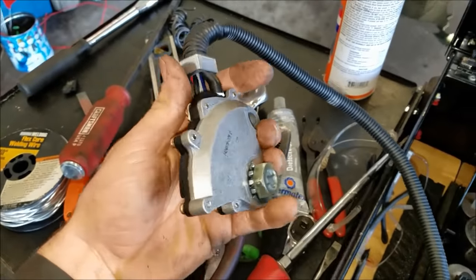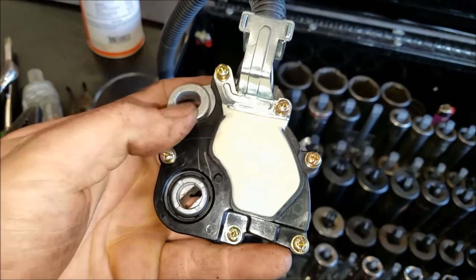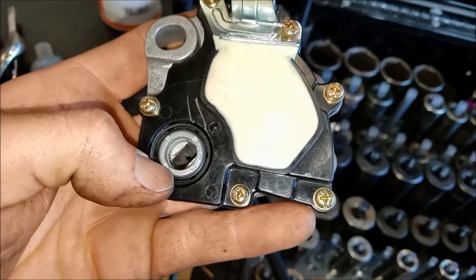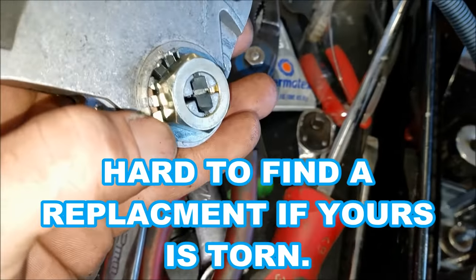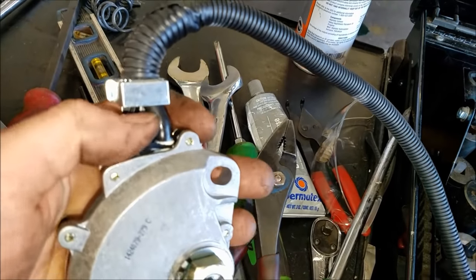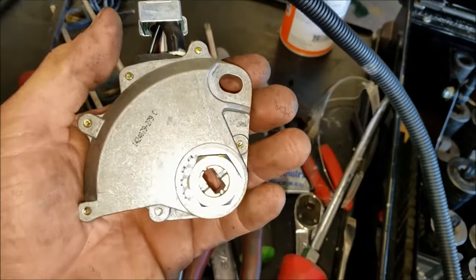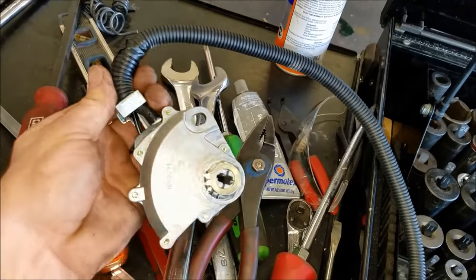Let's note here — you can remove this and then actually remove all these Phillips screws on the back and clean this thing out, but there are a few things that are not necessarily serviceable. You have a seal on this side and a seal on this side as well, and then you also have a ventilation tube that goes up into the harness here to keep water out of there, so make sure yours isn't cracked or anything like that. I'll put a link in there if you guys want to purchase one of these on Amazon — you can get them for a pretty reasonable price.